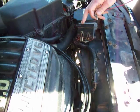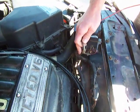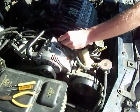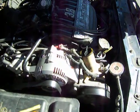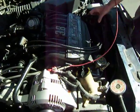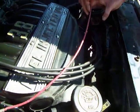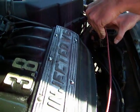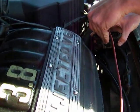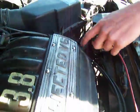To do a quick check, we can hook up power directly to the fuel pump and bypass all of the electrical circuitry. If we put 12 volts of power right to the pump, we can hear it turn on. The best place to do that is at the alternator over here — just slide this boot off, as it's connected directly to the battery. I'll plug in there and touch this to the number five terminal, and if you listen closely you'll hear the pump turn on. You can hear the fuel flowing through the fuel lines.